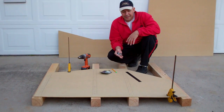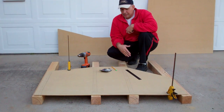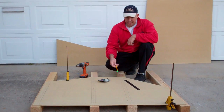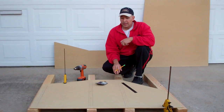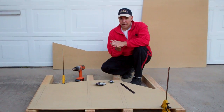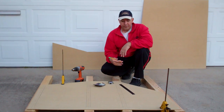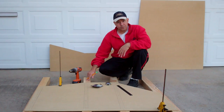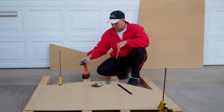You could paint these first as whole sheets, then come back, cut them, drill them, etc., then maybe do touch-up paint as necessary. But basically how I do it is I trace all my lines out, lay the frames down on the wall — as you can see, I trace out the insides of the wall frame so that you know where your wall frame members are going to sit. Then I mirror two sheets together, making sure they're mirrored properly. You've got to think three-dimensionally. Position the sheets accordingly, line them up, use clamps, use your floor cutting platform, cut out the sheets, and now we've arrived at the step of pre-drilling holes.